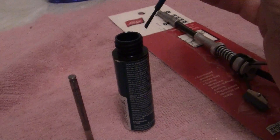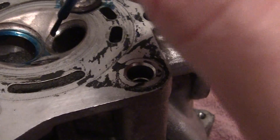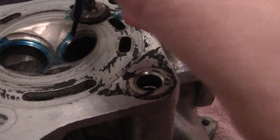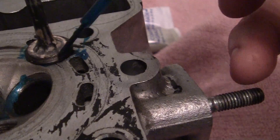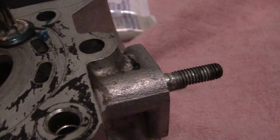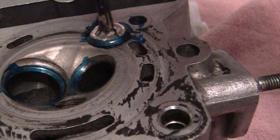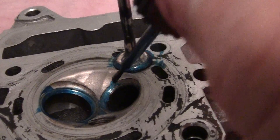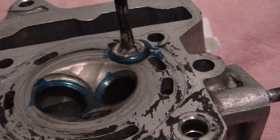So I'm taking my polish here, I've got my right hand. And on this exhaust valve, I've noticed it's not as shiny — this is the valve seat. It's not as shiny, and you can see where it appears different. On this valve, or the seating area, it shouldn't be totally beautifully clean like the intake, because on the intake you're only getting gas and oil — or just gas — through it, so it should be pretty clean. On your exhaust, you have exhaust going past the valve, being sucked from the cylinder into the exhaust valve. Of course it gets around, but it shouldn't be oily like that.